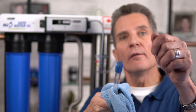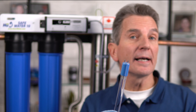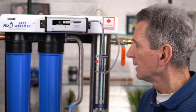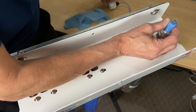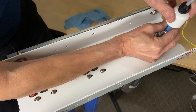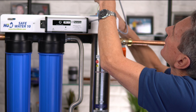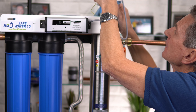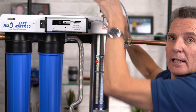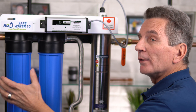Grab the new lamp and handle it only with the cloth. You'll see there are four pins at the end in two rows of two. If you go to put the connector back on top and it doesn't quite fit, just turn it 90 degrees — it can connect 180 degrees apart. Feed the lamp in, handling it by the ceramic ends, and set the cap on top. You may need to turn it 90 degrees so the pins line up. Push it all the way down — there should be no gap between the ceramic end of the lamp and the electrical connector. Then tighten the black nut just slightly, just enough to hold it in place.